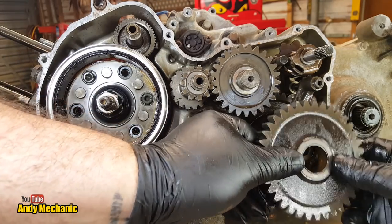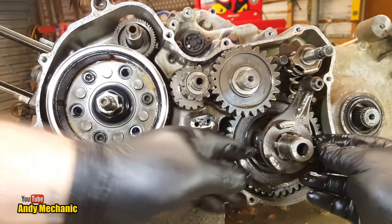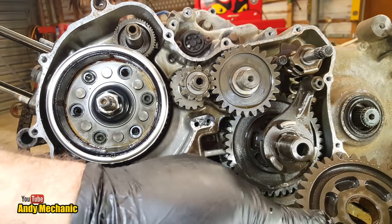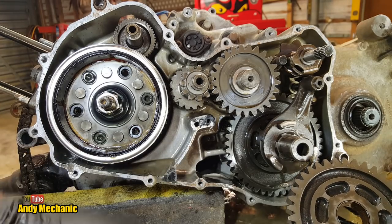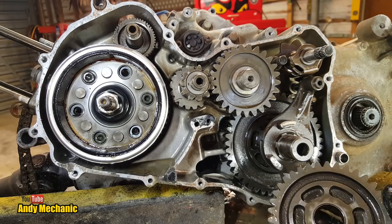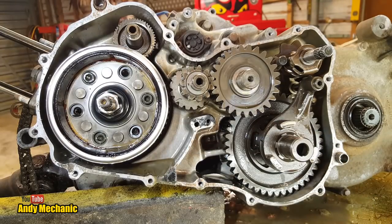Let's just pull the sub-transmission gears off, and you can see how it's actuated. Look, this fork will get pushed forward towards the camera, and it locks into these little ovals here. Look, these are what we call the dogs of engagement, and over time, there's my little screwdriver. Come back, little screwdriver.